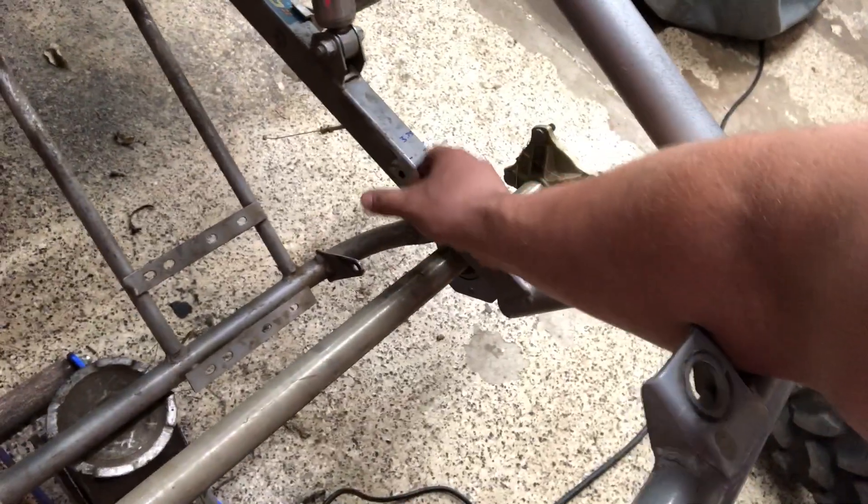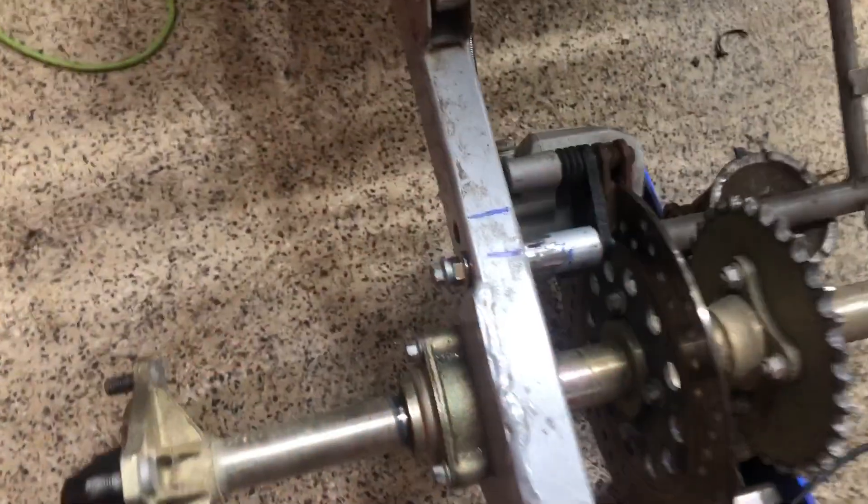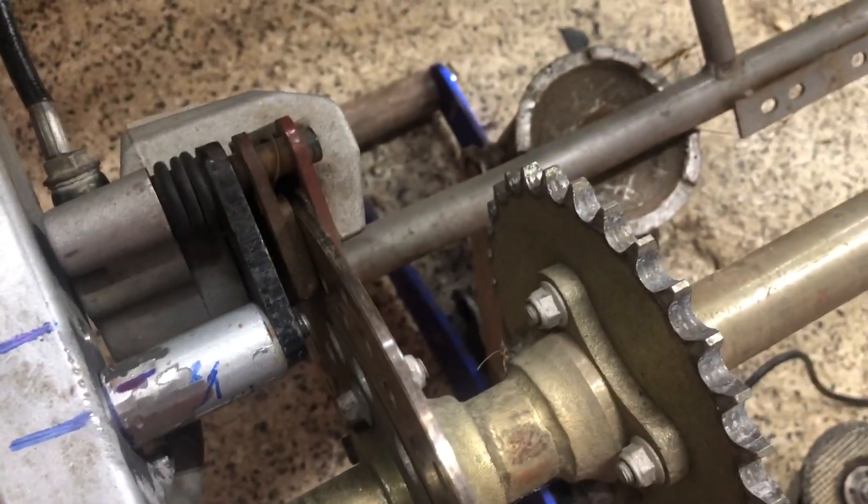On this side there was that longer piece — I cut that off and I'm going to weld that right here so that'll permanently locate it over. Just working on finishing that, I'll show you some progress updates. Here's the piece of this brake caliper mount — basically it's just a glorified spacer — cut it off from this side.